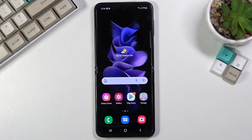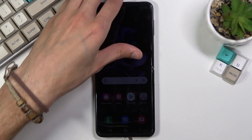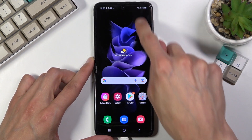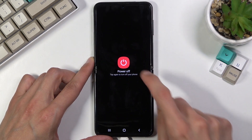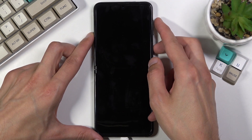For this you will need a cable that is plugged into your computer. As you can see I already have one ready — let's connect it to our device right there. So once you get that ready, I'm going to select power off, and once the device turns off, which is indicated by the vibration, you want to hold the power key and volume up at the same time.